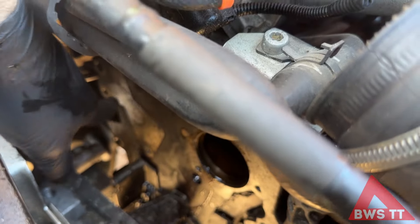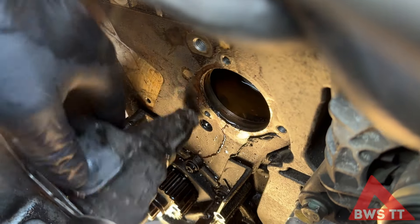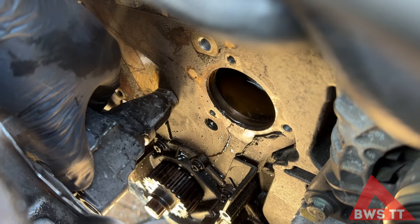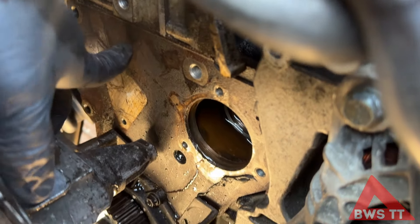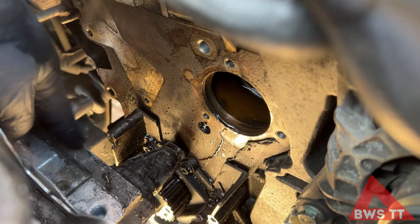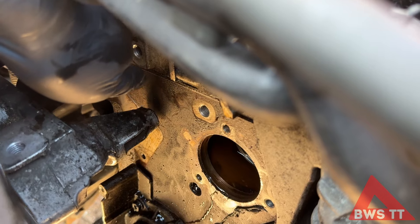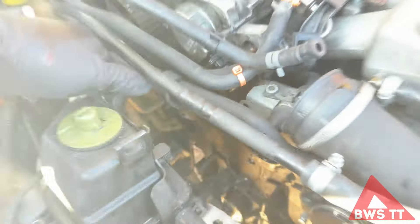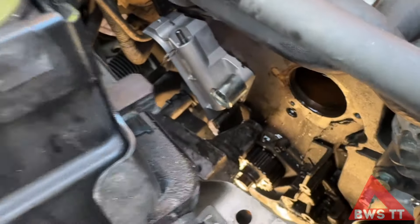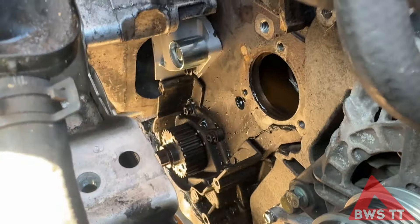In there you can see the outline of where the hydraulic damper lives. All you're doing as you're attaching it is working with the mount around, because to get it out it has to come past there — there's no room. If you come out the top it's got to come past the water pump, and it's got to come past the roller tensioner which lives there. So you just leave it out like that, bolt it in place, and it's really not that difficult. Once this is bolted in place, you rest it up and round, put the water pump in and the roller tensioner, and then the mount is just where it needs to be. This is what I mean by working around the mount — trying to take it out is just pointless. Just leave it in place and work around it.